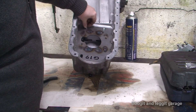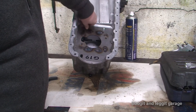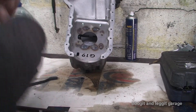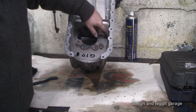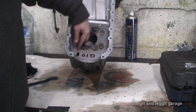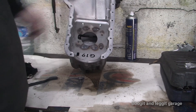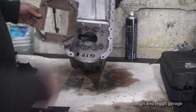I'm hoping there's nothing else to this — there was supposed to be a fitting kit with this, it never came, and I did email them and they never got back to me. So it should just be a simple case of doing this. I have all four of them on but they're not tight. You might think, well, the oil can't get in properly — well it can. These oil channels mean the oil will run behind here. This is not a fully tight fitting. Don't put any sealer here — if you put sealer here the oil can't get back and you will do damage. Obviously the oil will run over the top of here. The oil will get in, believe me. And as you can see from the hole we have here, it's the same — well, obviously the hole is slightly bigger than the pickup, but the pickup fits through there. You can see the whole difference between the two is huge, and you can see the way that worked really well.